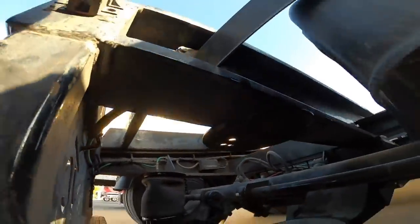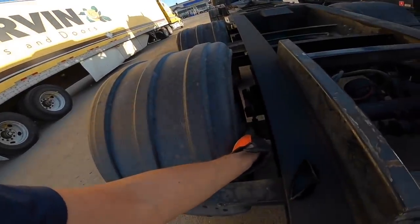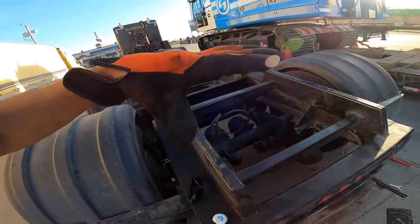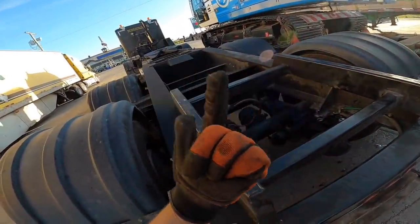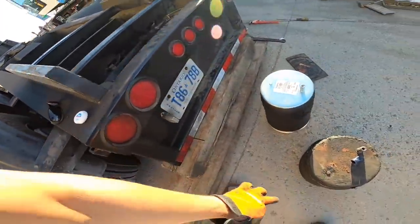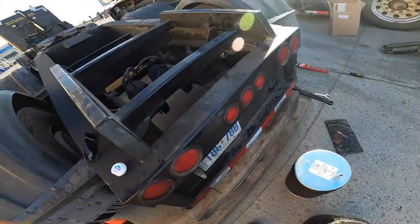And I think what happened, when we were lifting the Jeep, I forgot to tighten these, so the bag extended improperly, and probably when they were putting it down, this thing jumped from under that hole where it's supposed to sit, and it hit this, and then it just caved in and started leaking. So it's very important to install it properly.